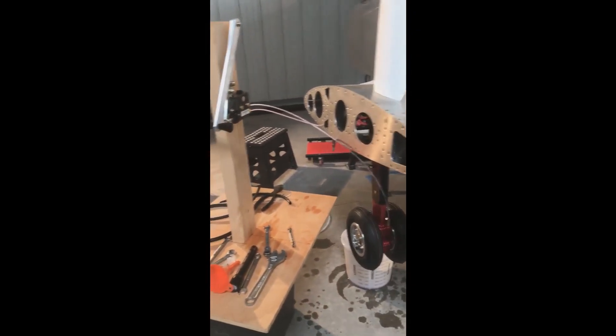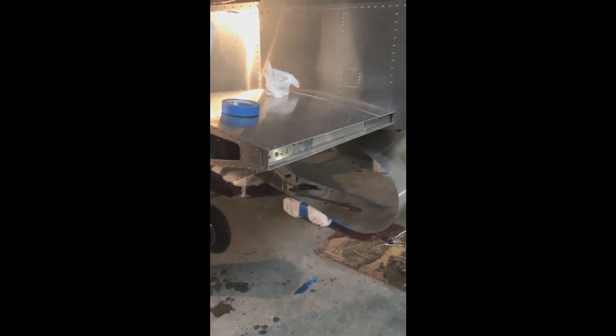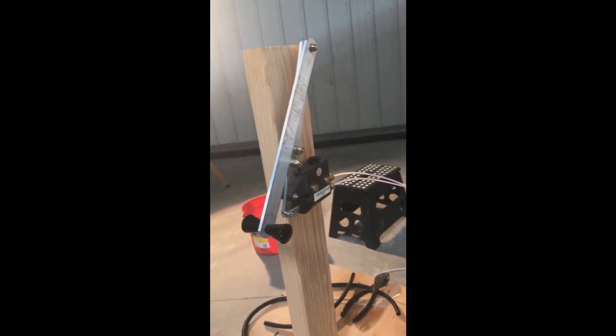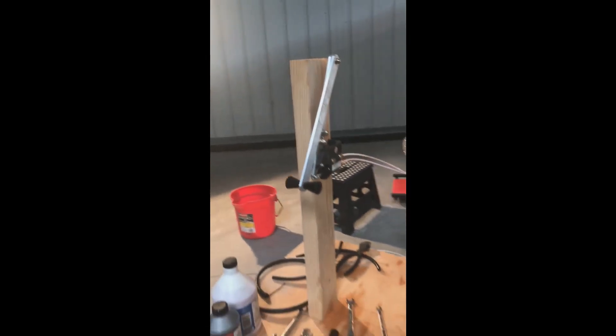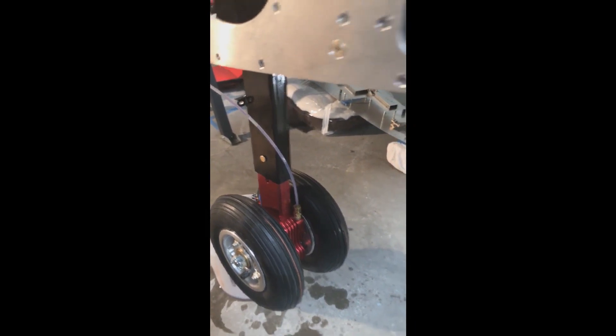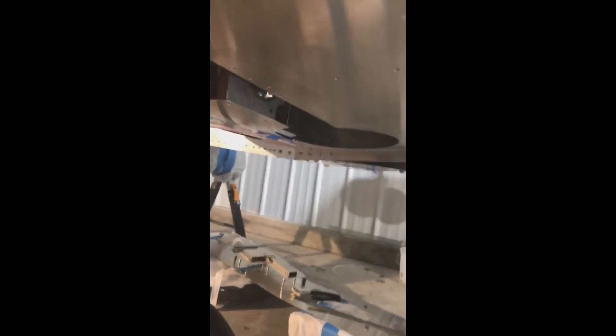I wanted to show you what I've been working on. It's very messy working with brake fluid and there's just no getting around making a mess unless you're extremely careful, which I tried to be but it just didn't work. So this is the brake handle, brake mechanism — that, believe it or not, is the master cylinder right there. I've rigged it up on this jig and connected the lines right here. This is the left main landing gear and that's the fill line, there's the bleeder valve in the front. I did the same thing on the other side — there's a line that runs over there to that side.